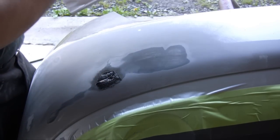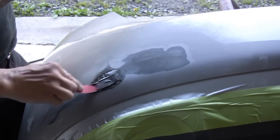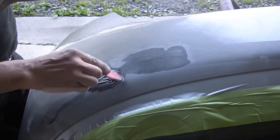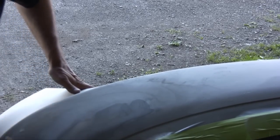We're going to do the front while the back is still wet — it hasn't hardened yet — so we're actually mixing the front and back repair together so it becomes one seamless front-to-back repair, which is very solid. Now we shape it with the sander.